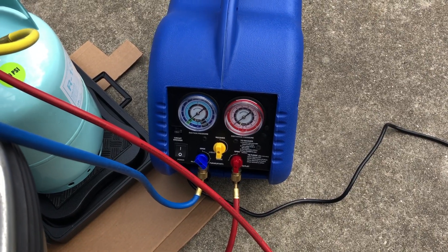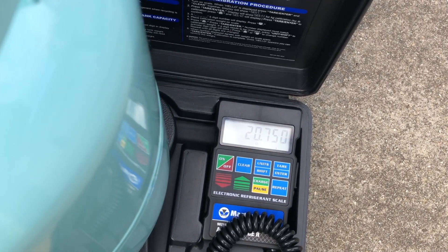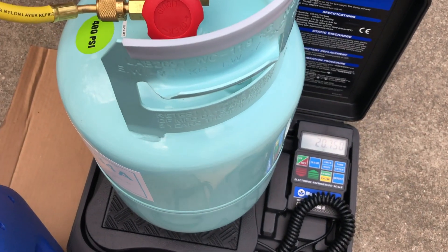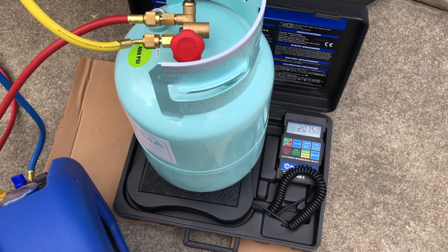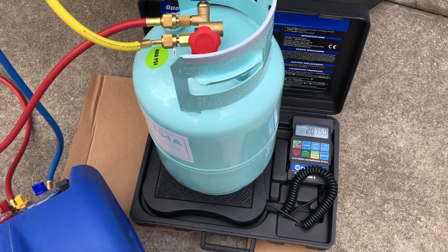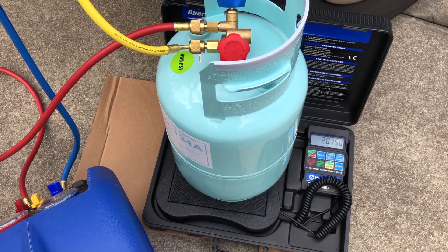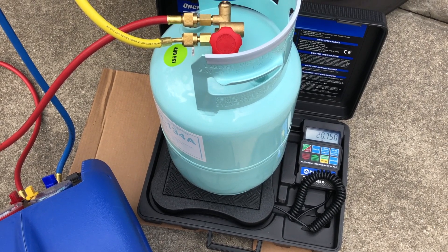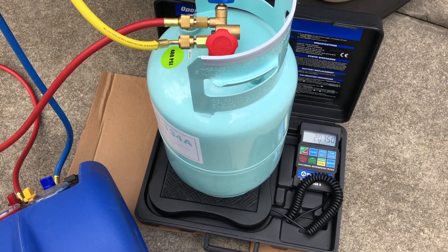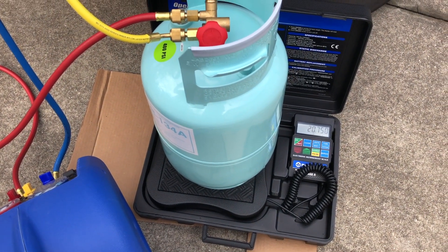While it's going we can take a look at the cylinder and see where we left it — we're at 20.75. It just shut off and finished the purge step. Going to walk over here and shut the switch off. At this point we're done — we've recovered everything we're going to be able to recover from this particular vehicle system. The next step will be pulling a vacuum on that system after we do the repairs. I'm going to get set up to do that vacuum step, and we'll show that vacuum-out process — that'll be the end of the demonstration.